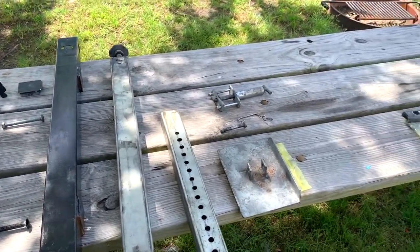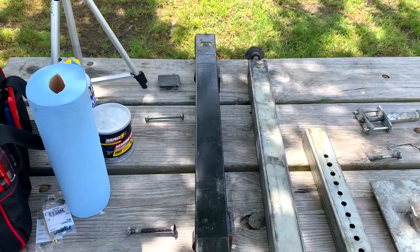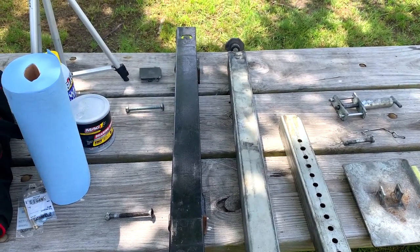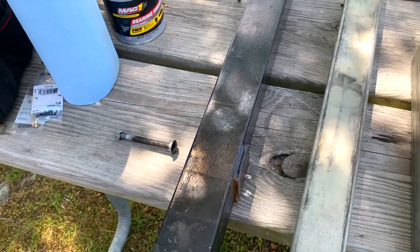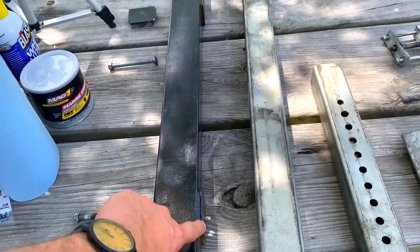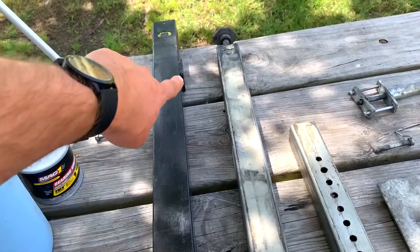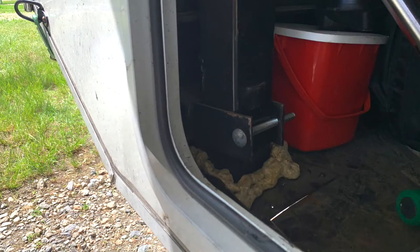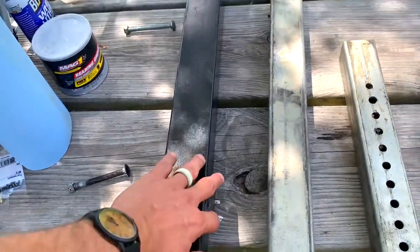So this is it all torn apart into its pieces. First you have the outer housing — this is really the strength part. This is the part that sits up against your frame and enables it to lift and lower your entire RV. One side has metal plates welded onto it and that's the side that goes up against the frame. When you're picking landing gear or trying to find replacement parts, they are measured by the outer and inner length between these two plates. These bolts are just holding it up against those welded plates — that's where all of your weight is sitting.